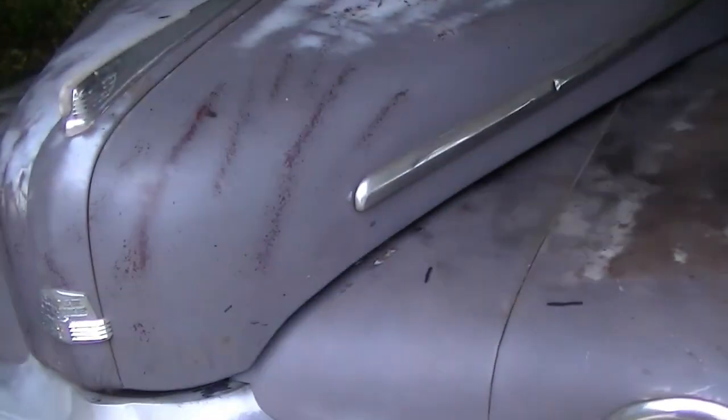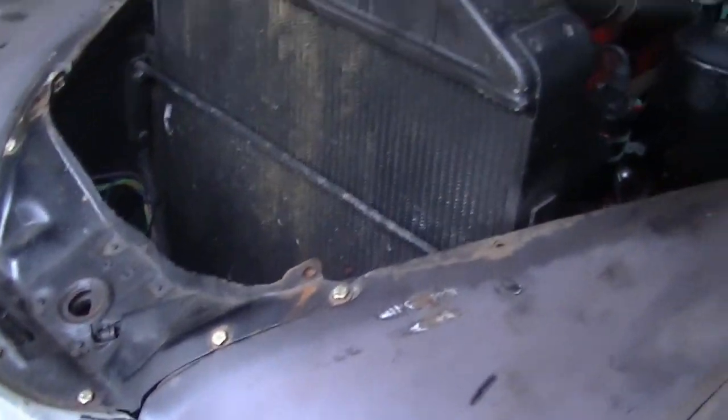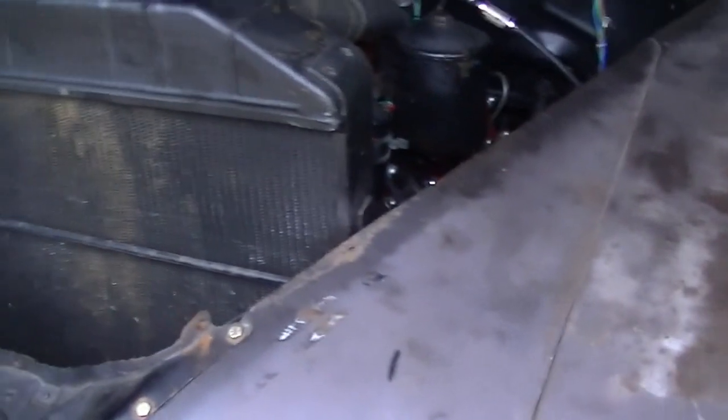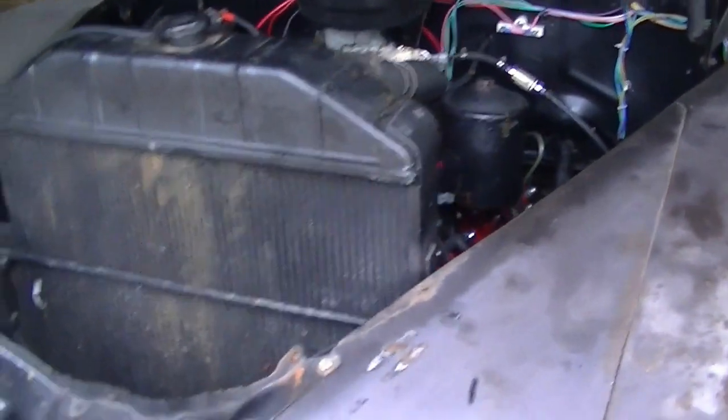My plan right now, and we all know how plans are, they tend to change, is to take the fenders off, obviously, roll the body out, but I'm going to make these wing panels, these parts of the fenders, because it's a two-piece fender, and if not, it will be. Take this part of the fender right here and make it removable. So I'll tie these in with hard mounts to the new chassis, the Ranger chassis, and make those filler panels